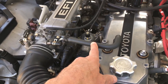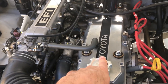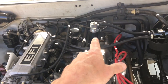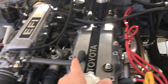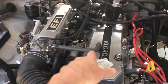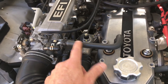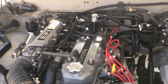The other purpose the fresh air breather serves is that when you do get pressure inside the engine, it acts as somewhat of a bypass pressure relief valve. Pressure from the crankcase, if it's not sufficiently being evacuated by the PCV system, can reverse here and go out and be drawn into the intake. I've tried all kinds of different things over the years — check valves, eliminating this, putting orifice reduction as small as 1/16th of an inch. None of that really helps out too much.